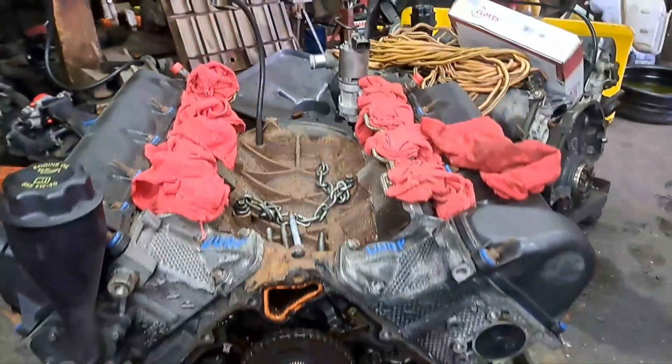It's always a good idea to rotate these engines clockwise because of the tensioner. If you go backwards, the motor is going to flex that little piece of polyurethane and it'll crack and break - it's meant to go one way. The timing marks on the sprocket sets are behind everything and you can't really see any of it, so it's a little tricky getting everything lined up.